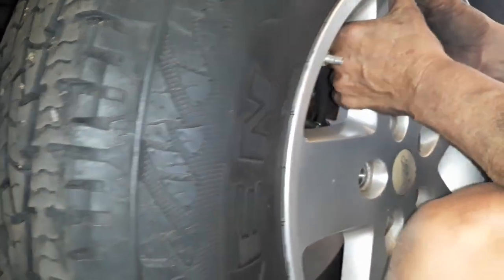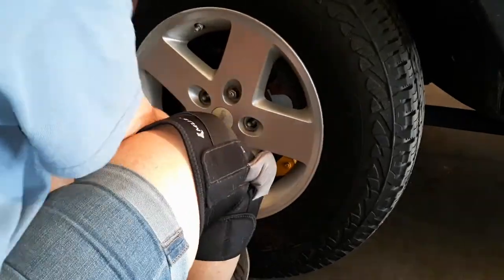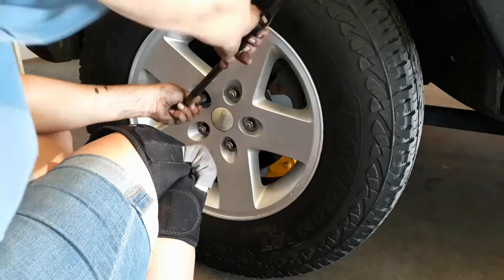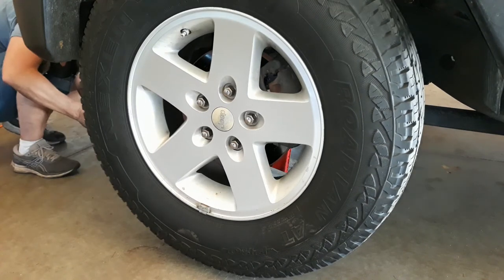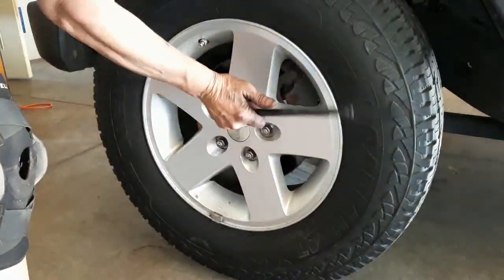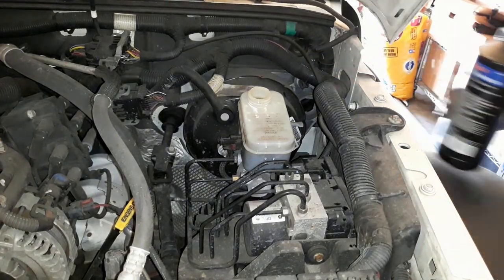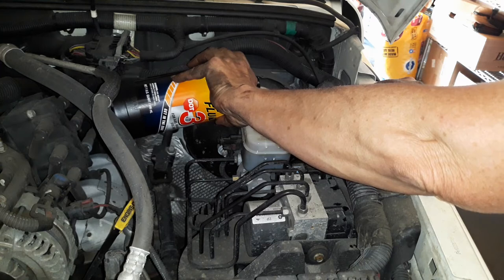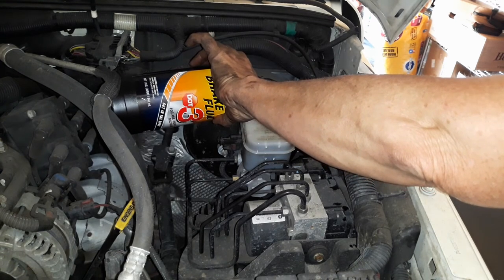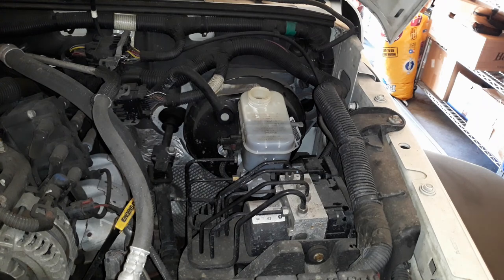The final step is to put your wheel back on, get everything snugged up as much as you can, lower it down so it has some weight on the tire, and then totally tighten it up — I call this my torque to 185 foot-pounds because I get on there. It is really that simple to do your own disc brakes. Then just go up front and top off your fluid. You can see the fluid filling up in the master cylinder as I'm topping it off — everything 100% brand new all the way through the lines to the brakes. I want to thank you all for stopping by, have an absolutely wonderful and blessed day. I'll see you next time on How I Did It.